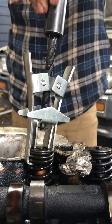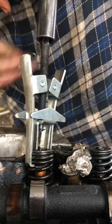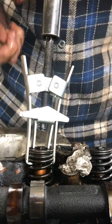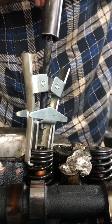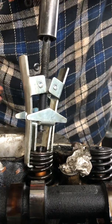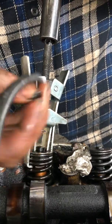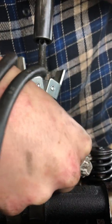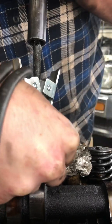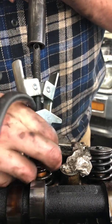Just doing the stem seals — I found the oil burner. One of the seals was definitely bad — one of them was upside down, the other one was just gone bad. The gaskets are around there, I'll show you in a second once I get this guy back in. It has the compressor on it, but when I went too many rings down it didn't like that and it kind of popped loose a few times on me, which was a little scary.